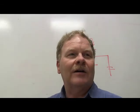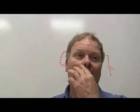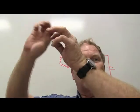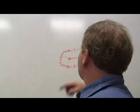All right, got that? So we hooked it, connected that, turned it to ground, turned on the key, boom, went to full. So that means you got a bad sending unit. It'd take hardly no time to do it. See, the wire was in a loom, and we found the appropriate color wire, the one we knew it was, right by the gas tank. We just used a little prick probe that bites into the wire. You hooked it to ground, that's how we checked that one there.